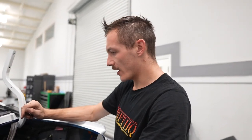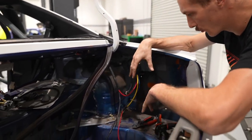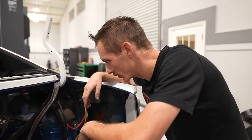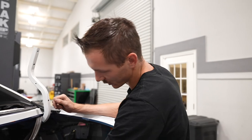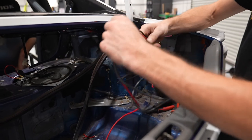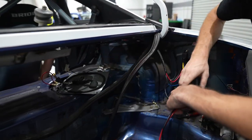I got the little relay kit wired up for the fuel pump and I'm just finishing it up. I'm going to leave the rear interior out of this section of the trunk so everything's serviceable in case you need to quickly diagnose something. It's always nice to be able to get to the fuel pump easily versus hiding it somewhere hard to access. I'm going to put some nice plugs on the other side so if I ever pull this top hat off, it's easy.